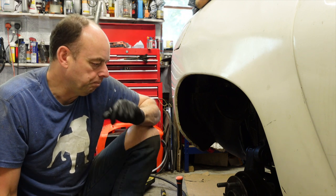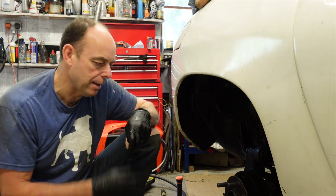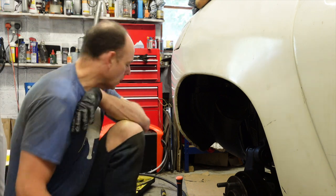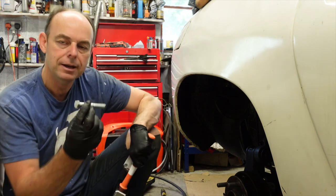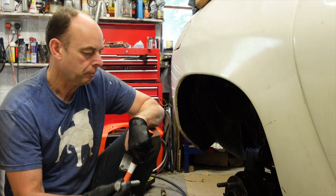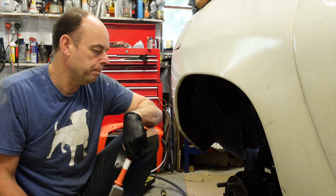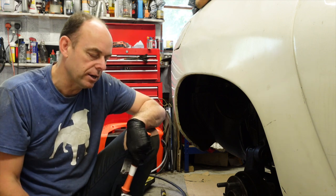So where I am at the moment is with a broken pivot pin, because both ends now have been flared out where I've smacked it with a hammer, with bits of weld on one end of it, which have snapped off, and I've tapped it back that way. I mean, it taps backwards and forwards relatively easy. So what I did was, instead of using my small hammer, I went and got a bigger hammer. So we're gonna start whacking it with a bigger hammer. I'm gonna use an old bolt I've got, well, a new bolt that I've not used, which is hardened steel. I'm gonna use that to help give me a bit more length so I can press it further. And at some point it'll just sort of fly out, but it'll just start coming out a bit easier. If I could have got a nut on the end, I could have put big washers and sort of wound it out against itself, but I can't do that.